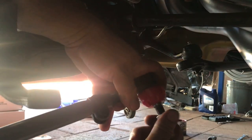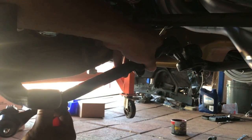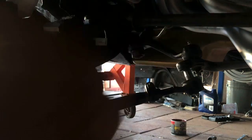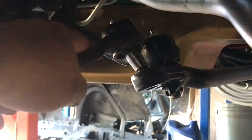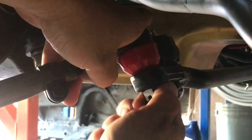The direction these go in isn't too hard — you can't really screw it up because the holes are tapered a certain way. Up here on the steering link they go facing down, so it goes in like that. If you try to put it in the other way, you can see how it won't go. The hole is bigger on one side and smaller on the other, so it can only go in one direction. You can see the threads sticking out, so we know this is the right direction.